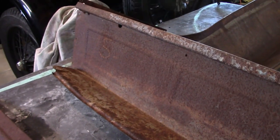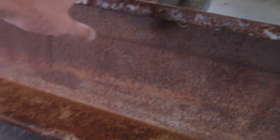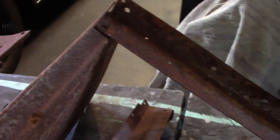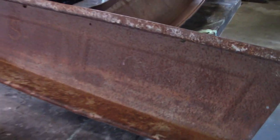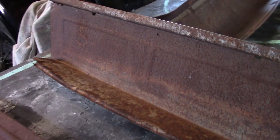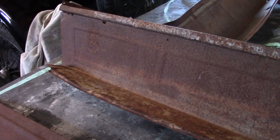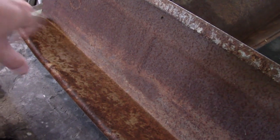This one over here, which was used by the beginning of 1916, is first of all a thicker-gauge steel — it's 17-gauge. It doesn't have a wood frame that goes on the inside; it holds itself together. It's got a flange here to hold the seat cushion, and they eliminated the wood frame that goes on top, so the seat cushion just sits here. Because of that, it's three-quarters of an inch taller than the previous one. And because it doesn't have the wood frame, the sides have these steel angles on it. It also has a section of floor down here and it screws to the sills. During 1915, more steel parts were being phased in, so there are a few bodies built that year constructed like a combination between these two — so if you have a car that doesn't match either one, that may be the reason. But this was the standard design they went with beginning in 1916.